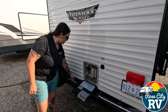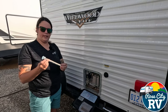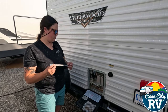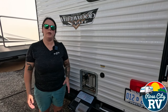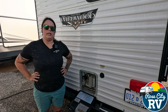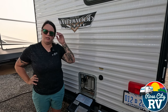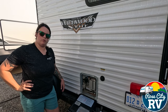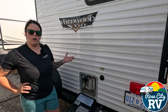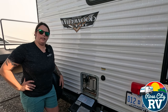To finish this off, I do not like to put the drain plug back in once I'm winterized — this anode rod is also a drain plug — because then I know that it has been done. So that's going to be the end of our winterization video. Hopefully that helped you if you're looking to do this on your own. We do offer a description sheet in-store, so if you need that or need us to email it, we can do that — it gives you a checklist so you can do this at home. Every RV is going to be different, but it's the same general purpose: make sure you get all those water amenities with antifreeze in them. If you like this video, please like and subscribe to see more like it.